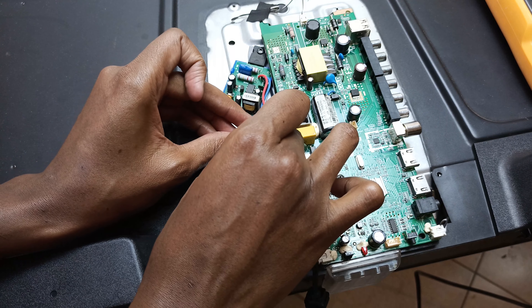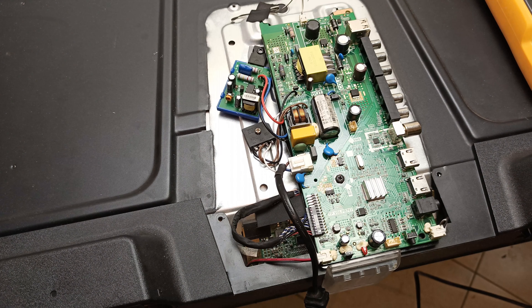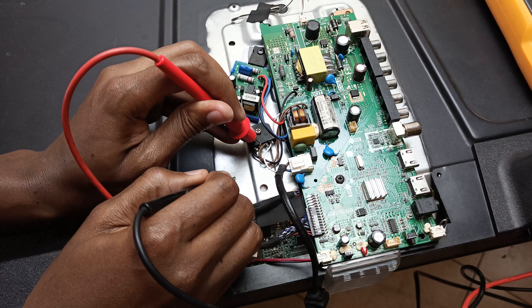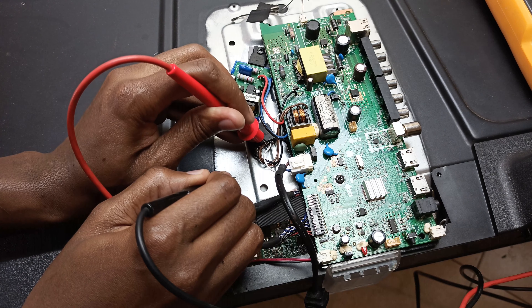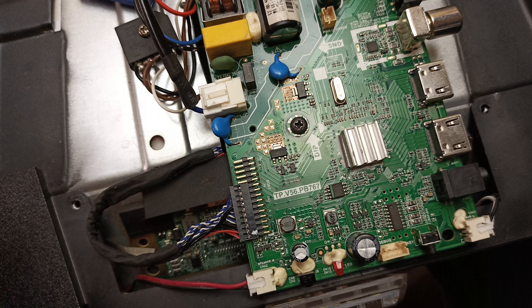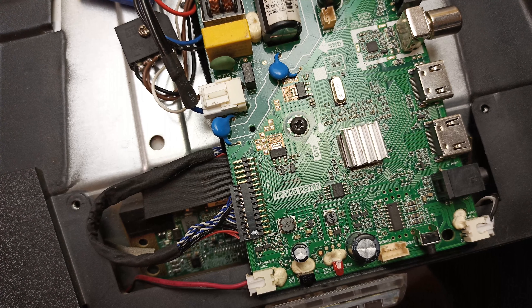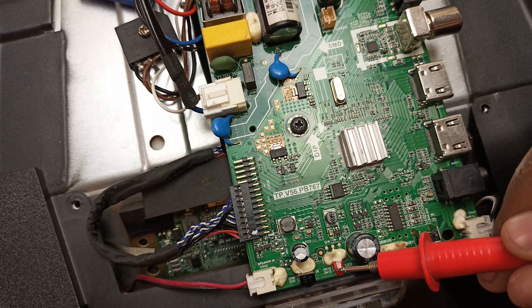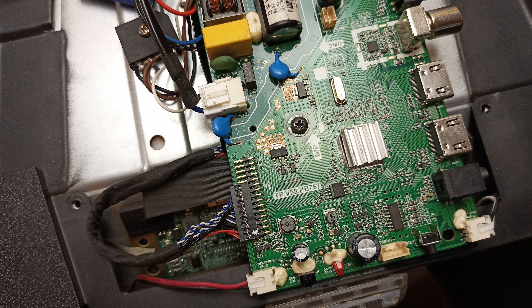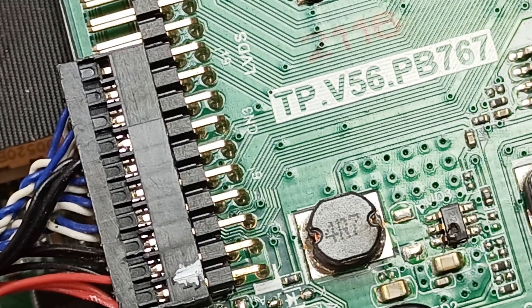The second thing is it might introduce a voltage that could damage the cold side, and I can't get a replacement motherboard. To counteract that, last time I used a plastic piece — not a very good insulator — but today I'm prepared. The white substance you see is heat sink compound, which fills the gaps in the metallic surface. Instead I can use this heat sink pad, which is a very good conductor of heat but a very bad conductor of electricity — exactly what I need.